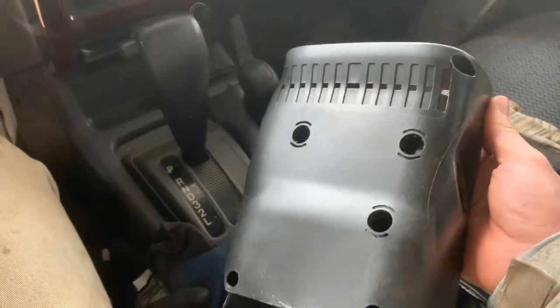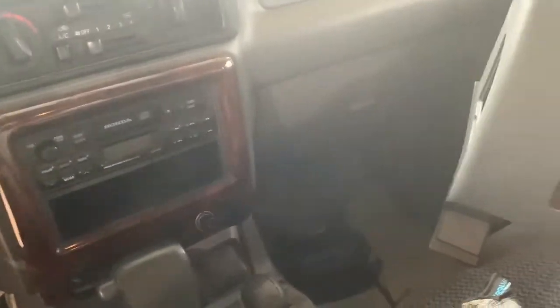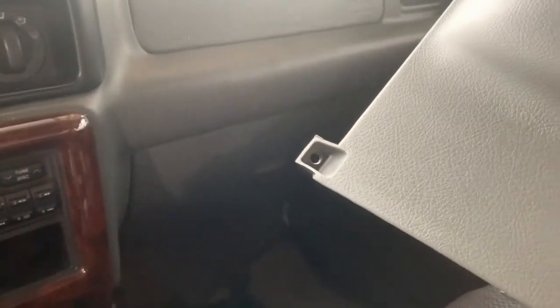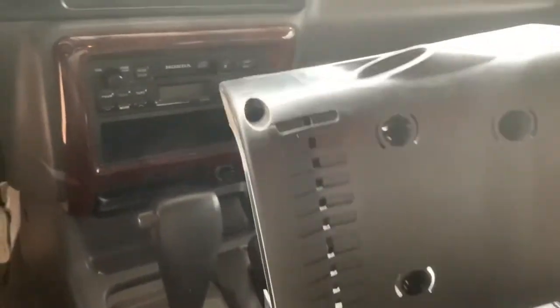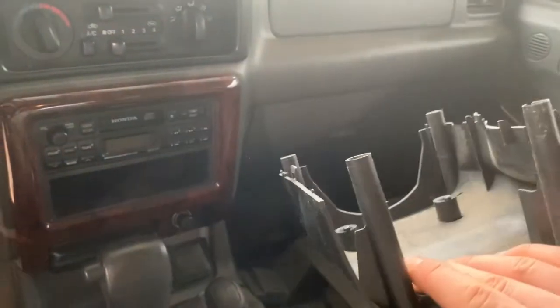To do this job — I wasn't even going to explain how — but this panel here just has a couple screws. The only screws it has are at the hood release: two Phillips head screws, and then one screw hole down here — total of three screws. That thing just pops completely off. Then here's the bottom of the column. You can see one, two, three, four, five, six, seven Phillips screws, and then the column cover pops off. That's how you access everything to do the job.